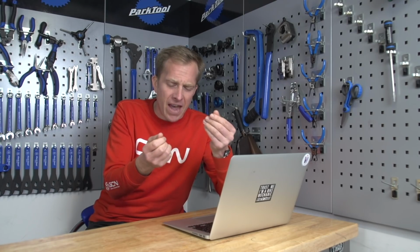But that powder, I've noticed that actually on quite a lot of tyres and tubes that have been fitted onto wheels for a long time. So something over 5 years, you find a bike, like I did that one on the street. When I took the tyre off of that rim, it absolutely stank. And also it was quite powdery inside of there. That could well be the sidewalls of the tyre gradually crumbling apart, if you like, and going inside to give that powdery effect.